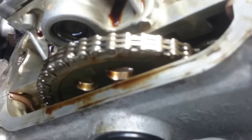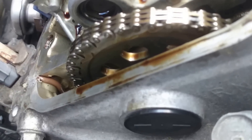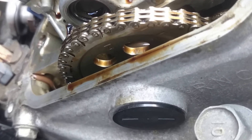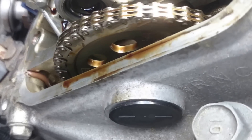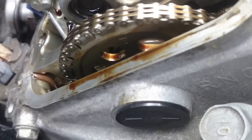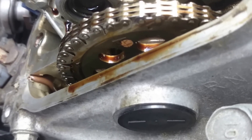That's now set for cylinder 3. When we rotate again, we're then set for cylinder 4. Once that line marks up again, make sure it's lined up really well. Then once we turn it again, it goes to cylinder 2 — it's working in firing sequence. That's the last cylinder you need to adjust, and you've adjusted all 4 cylinders on the engine.